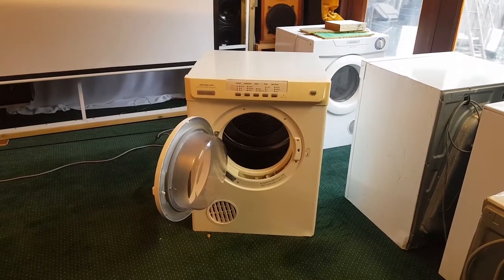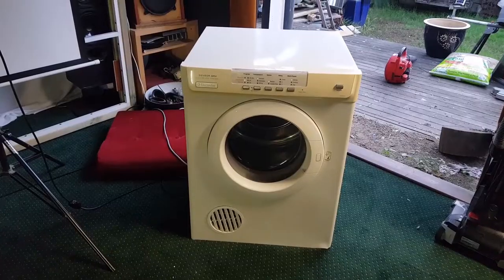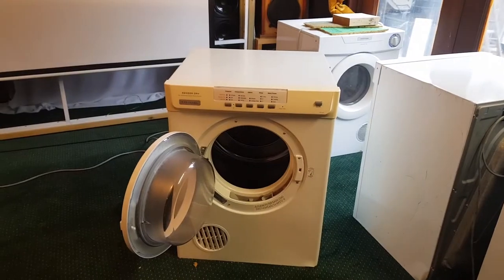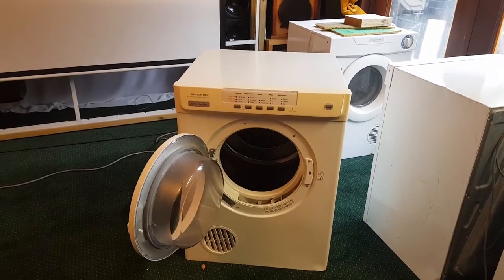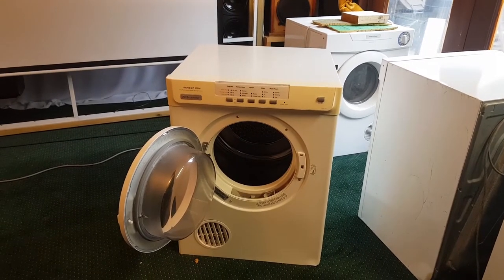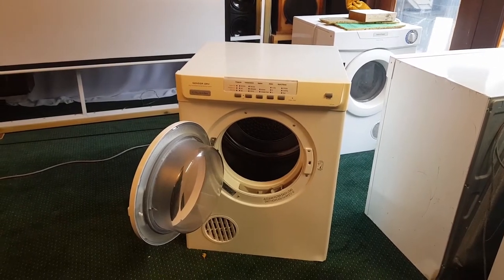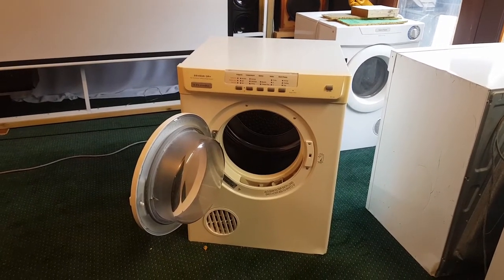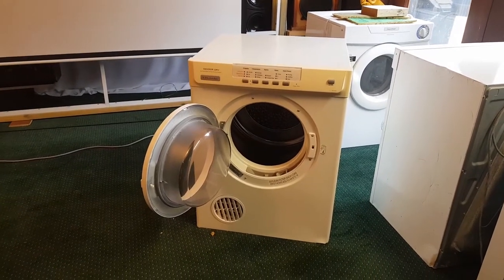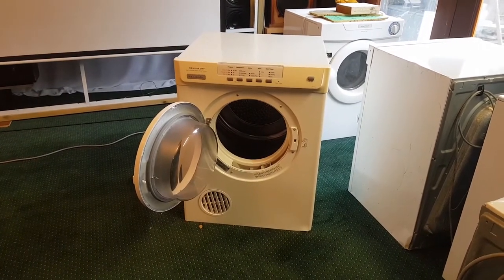Then I saw another part of the video where the back bowl, if you have a look at that edge, that lip down there, it was wobbling. When it was turning, it looked slightly warped or something like that. And I'm thinking that might have something to do with it. So what I'm going to do now is open this up and pull that fluff out of there and see if the bowl sits any better, and see if it's easier this time around to get that belt to stay on. I'll retest it and all that kind of stuff. I don't know if I'll put this in the video. I might do it. It's kind of interesting. We'll see how long the video is. But let's get into it.